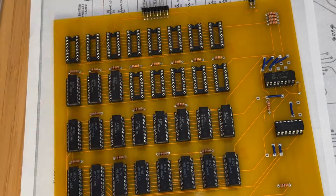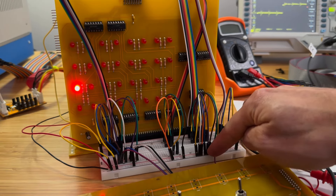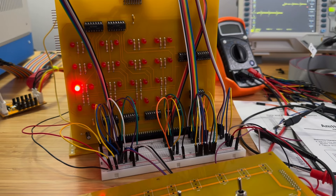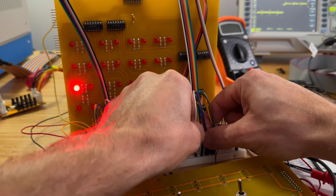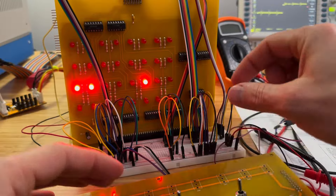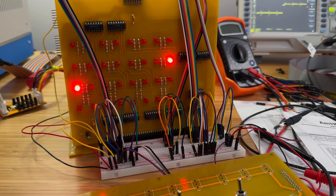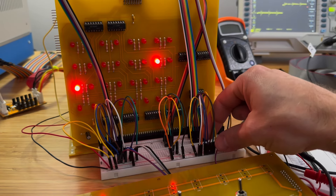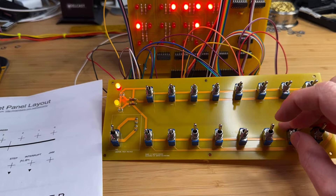Now that I have received the RAM — and I've got plenty of it this time — we can continue with our testing. Let's enter the test program into the Mark 8. First, set the computer in the jam and step modes. Then set the switch register to all zeros and toggle load address low and load address high. Next, set the switch register to octal 104, toggle deposit, set to all zeros, toggle deposit, and toggle deposit one more time. This simple program should run as a loop jumping back to memory location zero. Set the switch register to octal 005, switch out of jam mode, toggle interrupt, and then toggle step to step through the program.